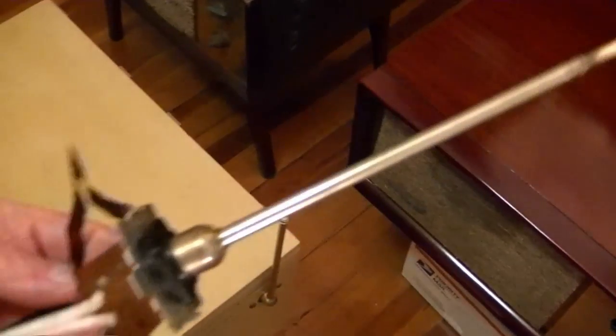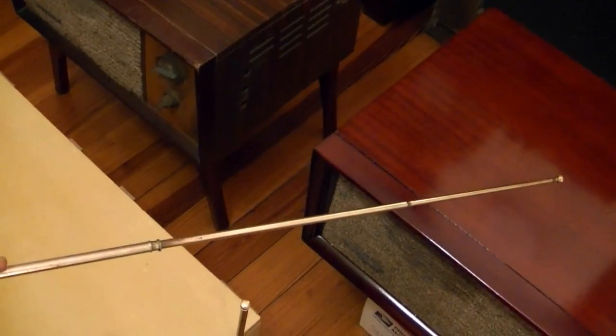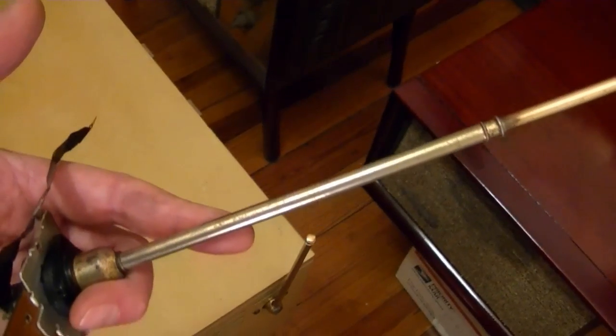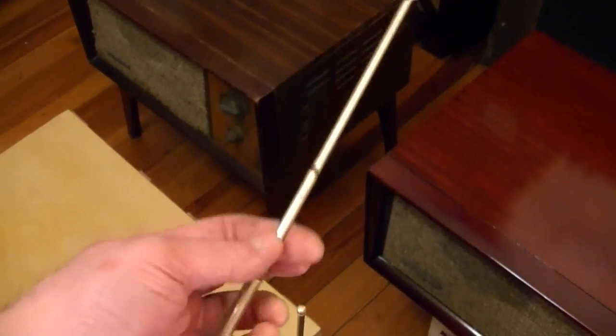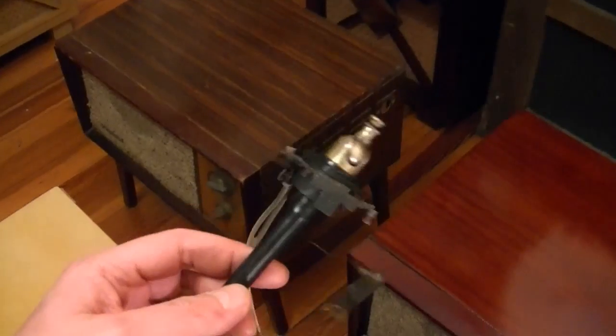This set did have the antenna, and I spent a little time cleaning it up. Unfortunately, Philco went a bit cheap on the antennas — the outermost tube is not solid brass but steel that was clear coated with a yellowish lacquer, while the innermost sections are actually brass, so I can polish those up real nice. When they're extended they look good, but the outer tube not so much. I noticed somebody is selling one on eBay with a buy it now of $295 or best offer. I think that's a little extreme — they may be hard to find, but I don't think they're worth $300. But good luck to him.